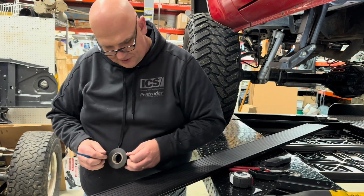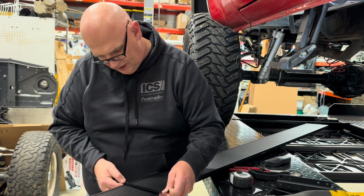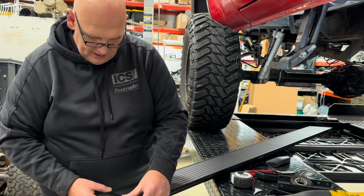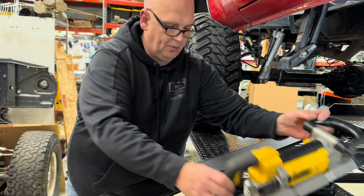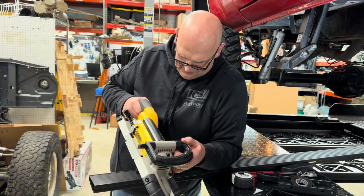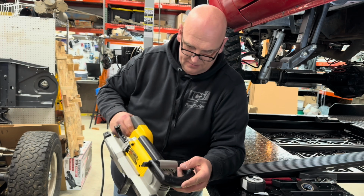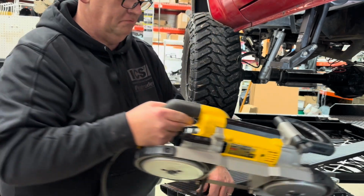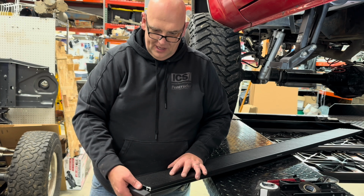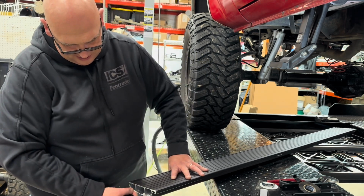We're gonna use electrical tape to get a nice straight line. And now we have our Portaband. We're gonna go ahead and cut this with our Portaband. Okay. And then all our sins will be hidden with that little plastic end cap. But we do want to make sure we get the burrs off this.